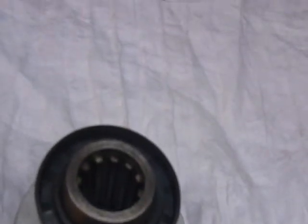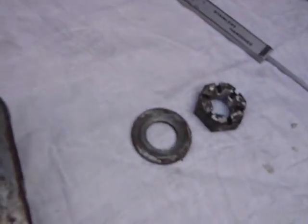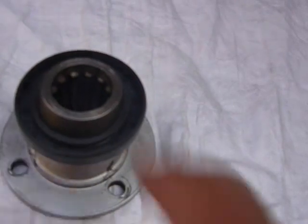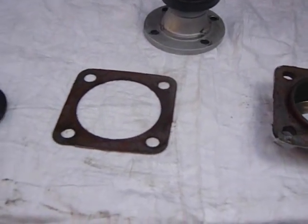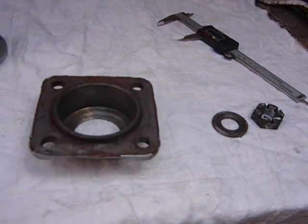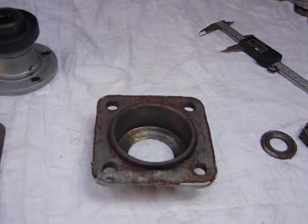So the seal people have thought that out very well. We're going to fit the new seal, discard the old ones, put the spacer back, put it all back together, put the washer on, tighten up the nut, fit a new split pin for safety, put the prop shaft back in position, put the four bolts in, start the engine and drive down the road in a happy fashion. Anybody who wants to do this job now has got a rough clue — I didn't have any videos to follow, but you've got one. I hope it helps. Most important bit of the whole lot: don't forget the cup of tea. Catch you later, bye bye.